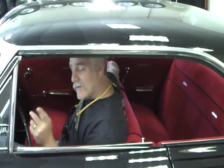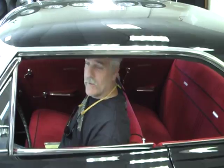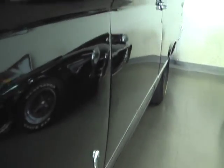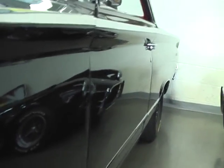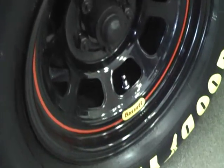The rough spot was on the passenger side quarter panel. We cut that out and TIG-welded another piece of metal in. It had a little spot in the floorboard — cut it out, took another floorboard out of another Mercury I had and TIG-welded it in so you couldn't see where it was patched, because the worst thing you want to see is a patch. This body is slick. We spent probably about 30 hours just blocking the car down and building the primer.